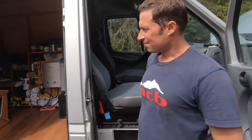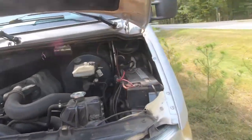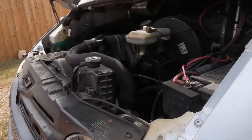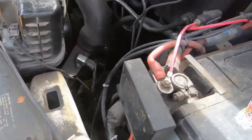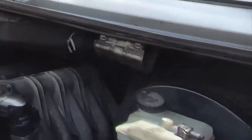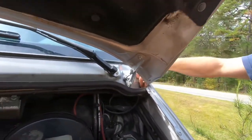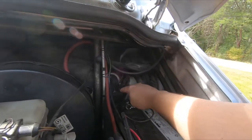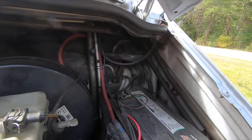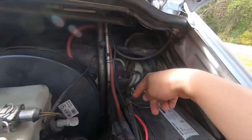You can hear this thing is already working. There's no smoke whatsoever anymore — you can feel the heat coming out. To keep a lot of this stuff nice, I paint it with a little motor oil to keep corrosion off. I live in a very corrosive area — they love to spray salt on everything. Some of these cables here, like the negative cable and the grounding, it's a good idea to put some oil on that because a lot of times people have a bad ground connection, which causes all kinds of issues.